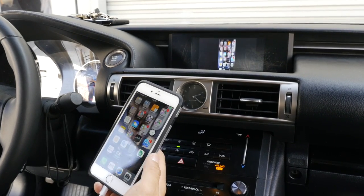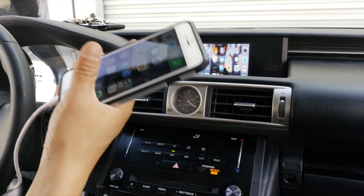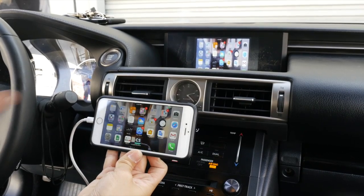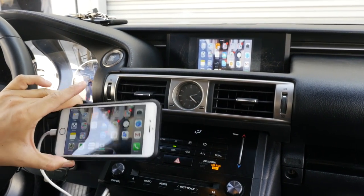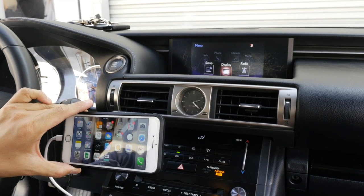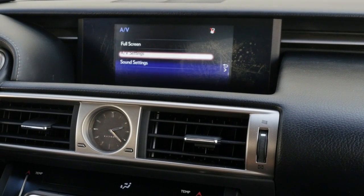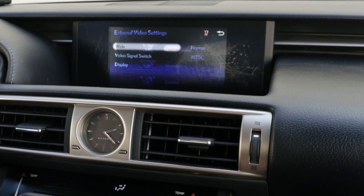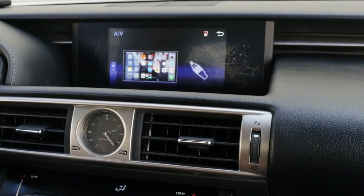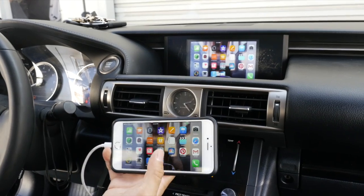We just finished putting all the panels back. The phone is still mirroring as you can see. The Lightning cable is coming out from the side — depending on how much length you need, it's adjustable; just push in whatever you don't need. When you first mirror the phone, the screen is not full screen by default. Let me show you how to adjust it: click, push down, go left, go to AV setting, and on the wide option click on it — right now it's on normal. If we want to put it to stretch, that will give you full screen. Now it is showing in full screen.